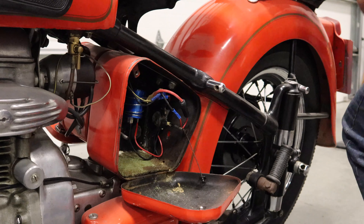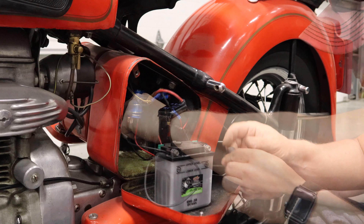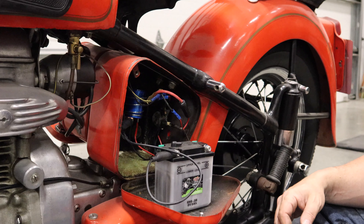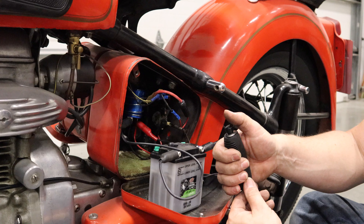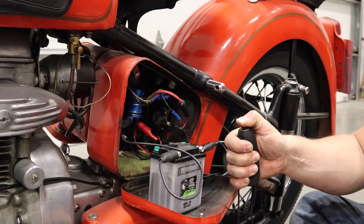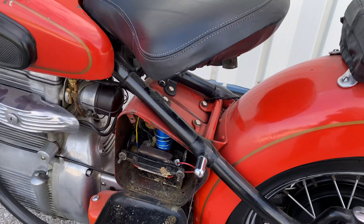Here's the battery that I had in there. Now here's the new capacitor — it has a positive terminal and a negative terminal. This is a 10,000 microfarad capacitor, rated at about 64 volts, so you could use this in either a 6-volt or a 12-volt bike. Lucas had their own version called the Lucas 2MC in the late 60s, where you could replace your battery with a capacitor.